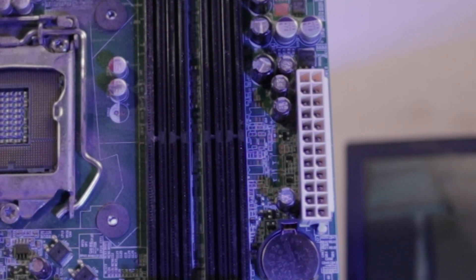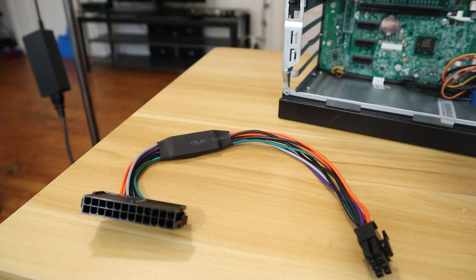Now that I've shown you guys the stock configuration and all the hardware upgrades, there are a few things you'll need to know to get this machine to boot in another case. Michael Dell did not engineer the Dell Optiplex to be used as a budget gaming PC in 2021. First, the power supply: if you have a first, second, or third-gen Intel CPU, you have nothing to worry about — it uses a normal 24-pin ATX connector. But if you have a fourth-gen Intel CPU in your Dell Optiplex, you'll need a 24-to-8-pin adapter, which is around $8 on eBay — I'll leave a link in the description.